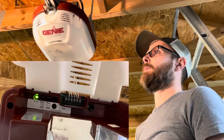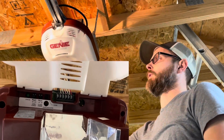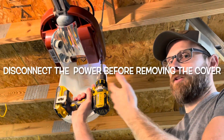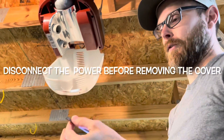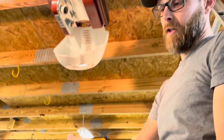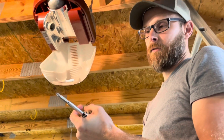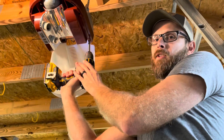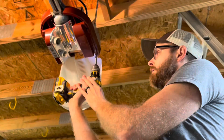We're going to talk first about the different error codes inside the unit. These screws have been in place for a long time — they're actually really long screws, so you want to use a screw gun. If you're having issues with the bit head bouncing off the machine screws, set your torque low so it acts like an impact driver, then step it up until it gets loose, and bump the torque to get more spin.